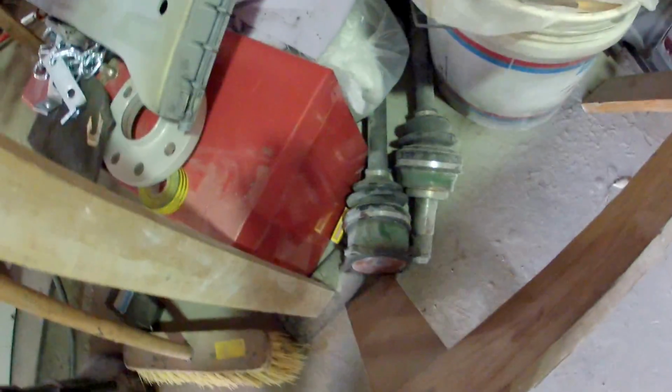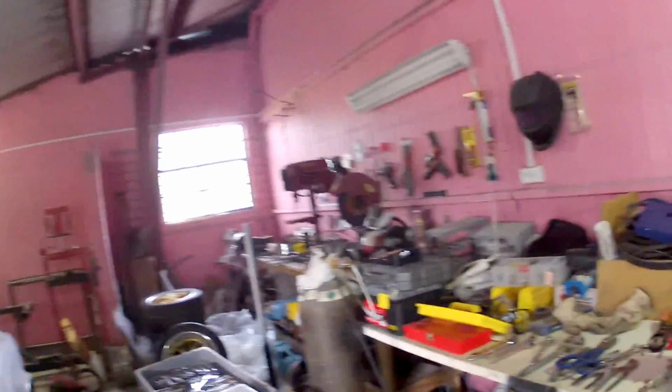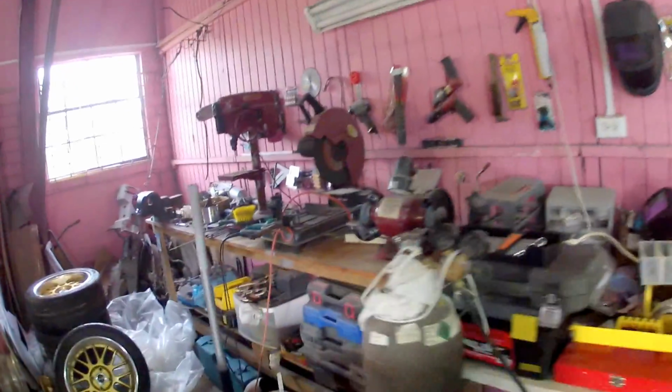We have the 300ZX half shafts, which have been shortened a bit by flipping the bearing cage, a necessary mod for them to fit on the 280Z with the original R200. Fairly simple mod. The original U-joint half shafts would not have lasted very long with the power we expect and the setup that we're using, so that was a necessary mod. I'm sure I'm forgetting a few things, but that should cover the main parts.